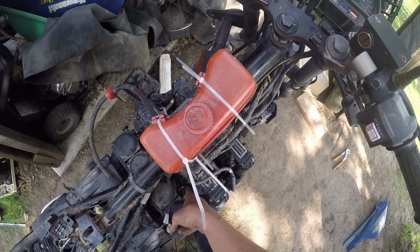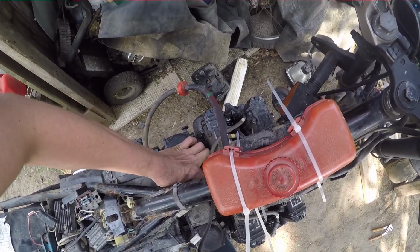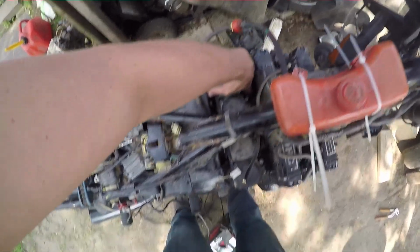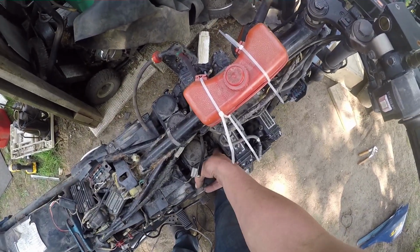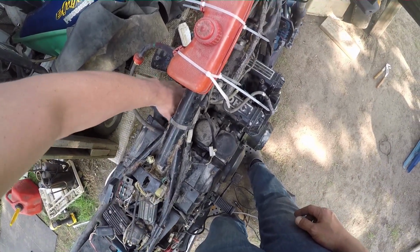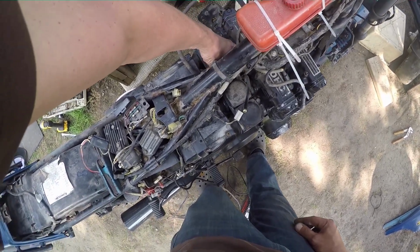That's just giving one cylinder throttle. You can hear it upset the balance. And then if I do all four, nice and smooth. And this one? No, that one's not as obvious. But yeah, you can tell this one upsets the balance. I didn't think it'd be quite that sensitive. Sounds like it's running pretty good.